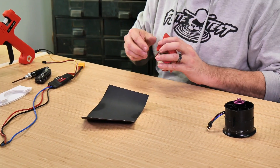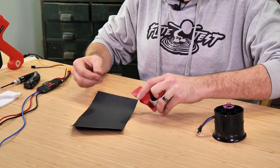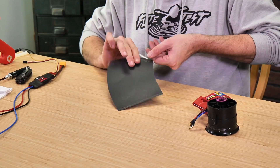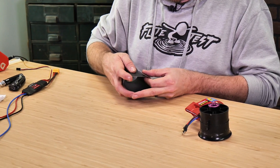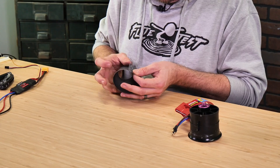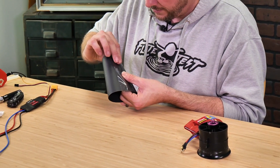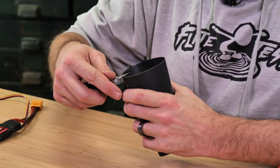There are a couple different ways to do this. The easiest way is simply a piece of tape. I'm going to place a piece of tape on the far side here, just like you see, and now we can roll this around. I'm going to line up one edge first — usually the very tip — tack that down, then line up the rest and press it into place. Once our exhaust tube is taped up, trim off any excess you may have.